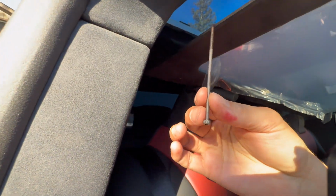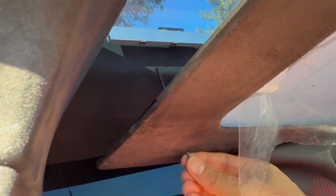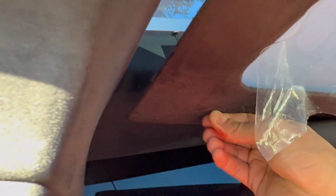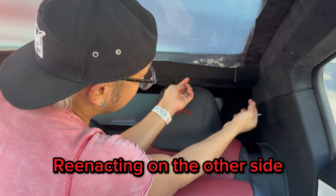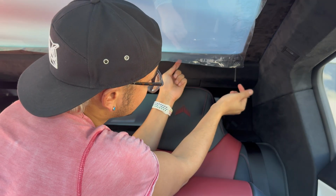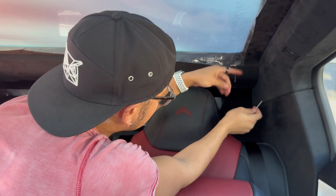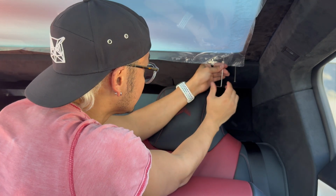So to put up the backside, they give you a very long screw. That's very clever because I need to be able to screw these into those tiny little holes from way over here. So that allows me to use one of these holes, and it's so long that I can guide it into that rail to line it up. So I need both my hands, so I'm gonna screw that in. It acted as a sort of guide. So once I was able to position that, screw it in place, I was able to push this roof up that longer screw. And now these shorter little buttony screws should line perfectly up with that initial bracket that we put in place.